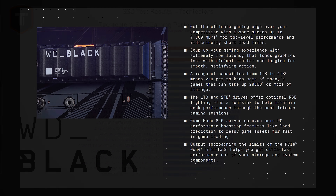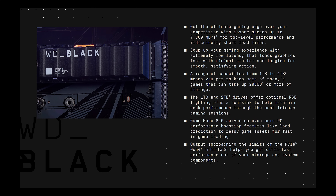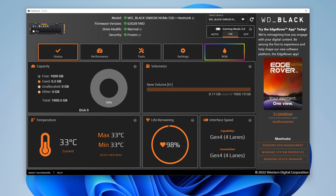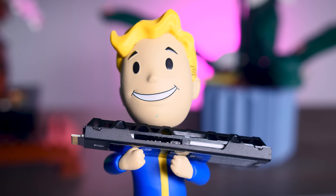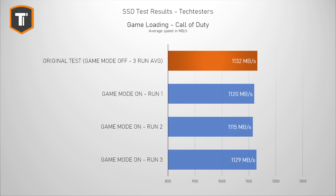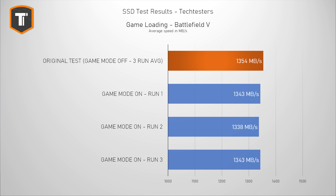Western Digital is advertising a feature called Gaming Mode 2.0, which is supposed to improve game caching and loading even further. So I installed the WD dashboard, which is actually pretty useful — you can check for firmware updates, make sure your SSD is connected at the correct speed (PCIe Gen 4x4 in this case), and it also lets you change the little LED on the top of the heatsink, although in my opinion this is not really enough to call it an RGB feature. I went ahead and switched Game Mode 2.0 on, rebooted the PC, and ran every gaming benchmark three more times to see if game loading times improved. But they actually didn't — the results even averaged slightly below the first three runs without Game Mode on. Maybe it will work better in other scenarios, but from our testing right now, it doesn't seem to be something you need to turn on. Or at least not yet — maybe they will improve it in the future.